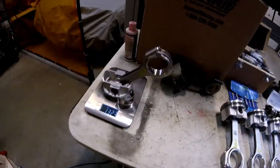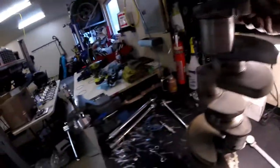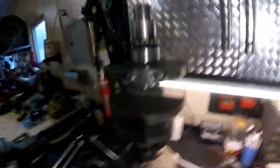Because the aftermarket rods and pistons were heavier than the factory ones, we actually had to balance the whole rotating assembly and add heavy metal to this crank. You can see that tungsten slug right there — it's twice as heavy as steel. We got one in that throw and another one in this throw. Because the pistons and rods were heavier, we had to add some metal to this factory crank.